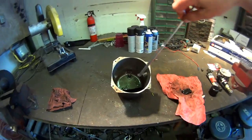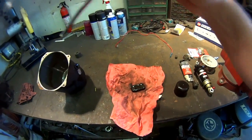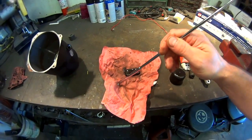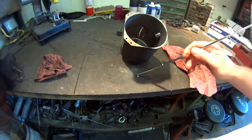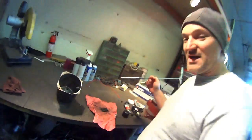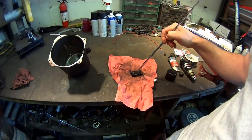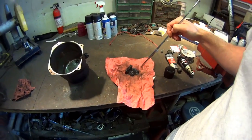Once you get this down, you're going to clean all this in here. And this is a magnet that's actually inside the tank. Clean this extremely well, and make sure you don't put it down on your workbench with a lot of metal flake so they don't get stuck right to it. Just common sense, but I figured I'd say it anyway. Clean this magnet the best you can — this has a lot of crap on it.